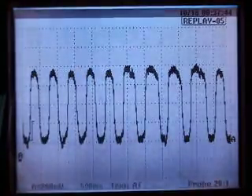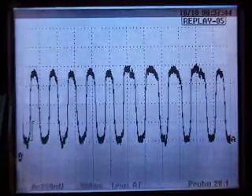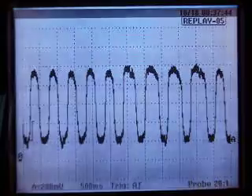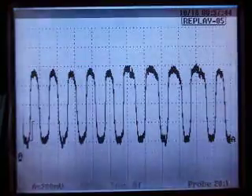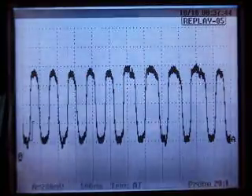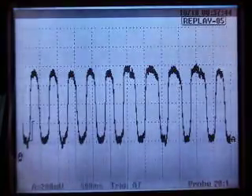This is our second time video and this one is checking the switch time on an oxygen sensor. In order to check an oxygen sensor correctly, we need to know exactly how quickly it can switch between around 175 millivolts or less all the way up to 800 millivolts. A low voltage from an oxygen sensor signifies a lean mixture and a high voltage a rich mixture.